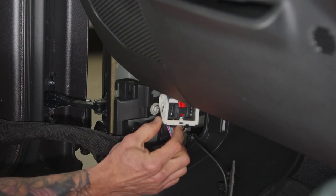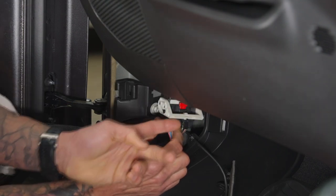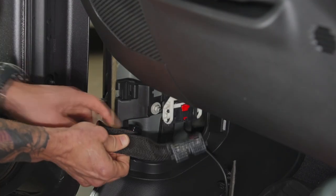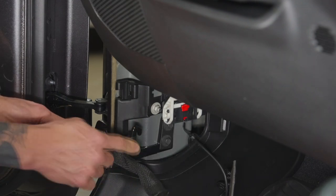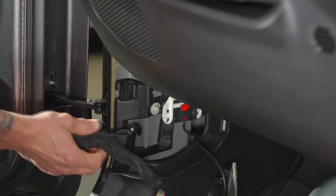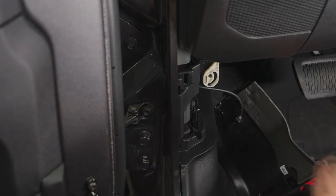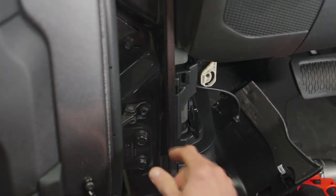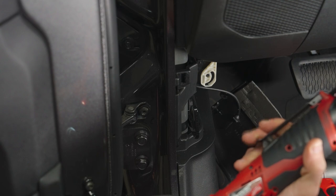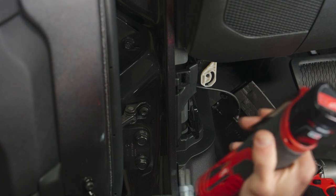There's a red button — push this up. There's also a black button underneath the little white bar; push the black button in while you flip the bar up all the way. This releases the harness. Next, remove the strap from the hook by swinging the door in a little bit. Then remove this T40 bolt — if this is your first time, you may need a handheld socket rather than a drill, as it may not be powerful enough to break the initial factory seal.